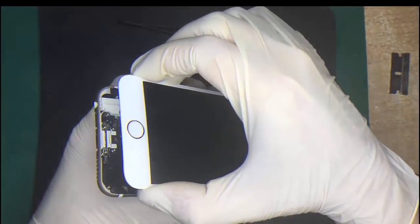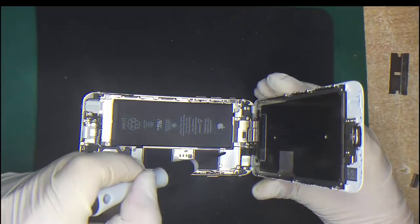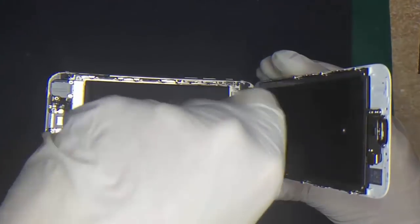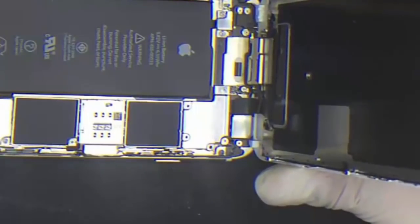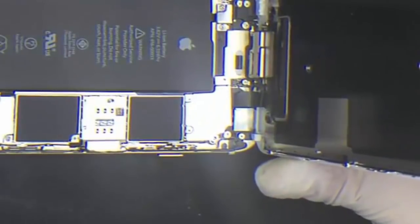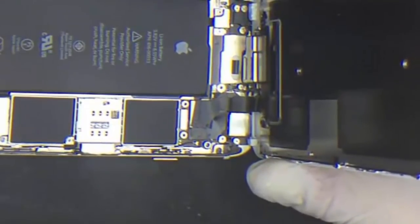What you have to do is slowly pull the bottom up. I'm flipping it up that way and it'll expose the cables connecting to the actual main logic board. Now there's a plate with four screws — just remove those four screws. Once those screws are removed, remove the top plate, which is fairly easy, and that will expose the actual cables that are connected to the logic board.